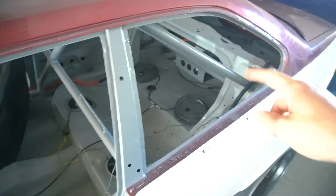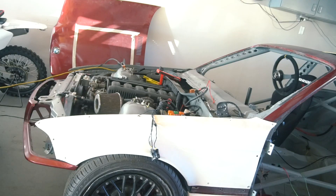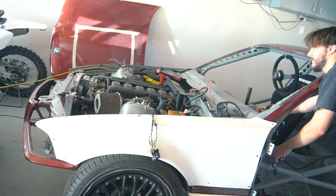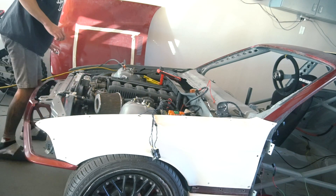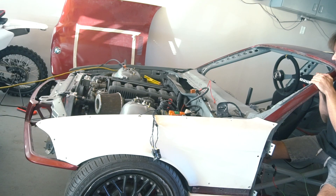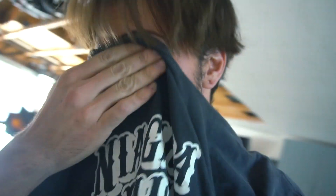So I got a jump starter. Last time I just had it running, I realized the ground fell off the fuel pump — that's why it cut off. So this should start it. Alright, well, it started, but I am dying in here with these gas fumes. The thing is just headers right now. It ran — that's all that matters.